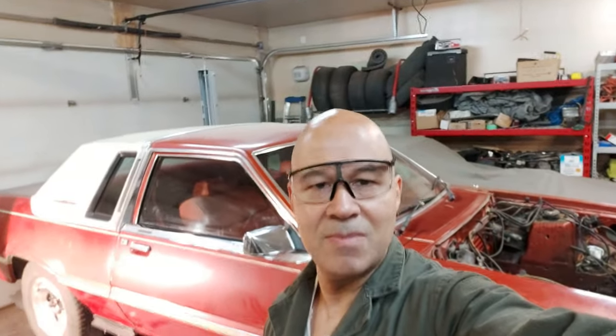That's a little video on the Wilwood proportioning valve I just installed. Hopefully it works without having to replace the master cylinder, since we've now got disc brakes all around — 11.5 inch in the rear and 10 inch factory ones in the front — using the stock master cylinder with the proportioning valve. I want to make a second part once the car is running. Thanks for watching Project Turbo LS — we're all locked down so that's why I'm making more videos!